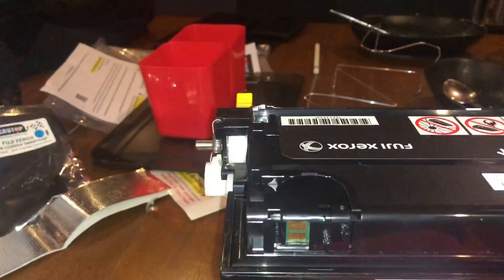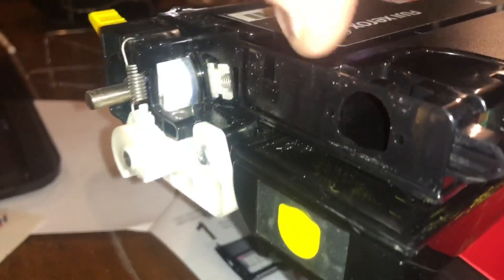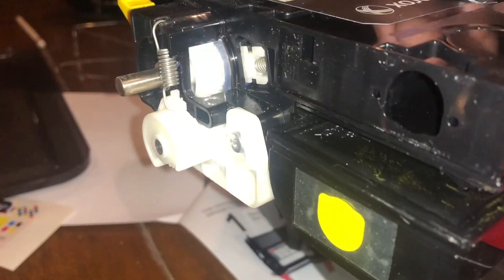The process on the document suggests starting with a safety razor, which I have here, to take off the end plastic, to clean up the surface of adhesive, to replenish the toner from the bottle, and to tape it up again. Now, I thought initially these were high capacity cartridges, but they're not. A high capacity cartridge would have both sections covered with a yellow mark visible; the low capacity one is just the bottom one. So I'm expecting I'll only have enough space to populate the bottom cartridge.